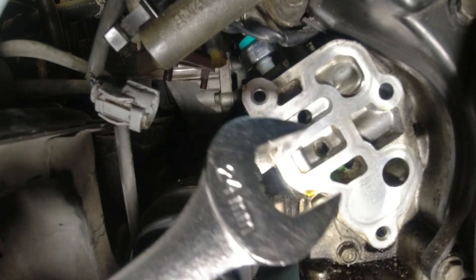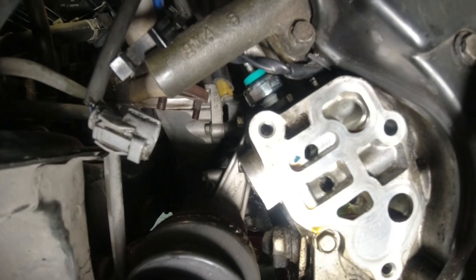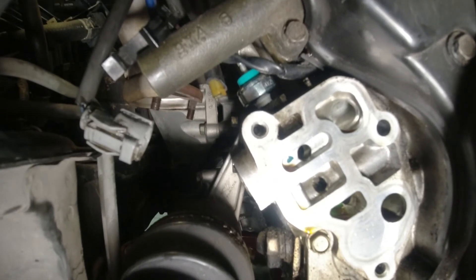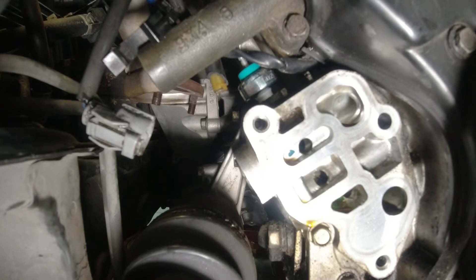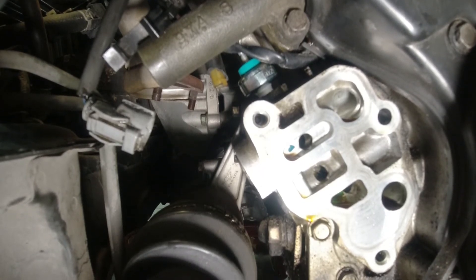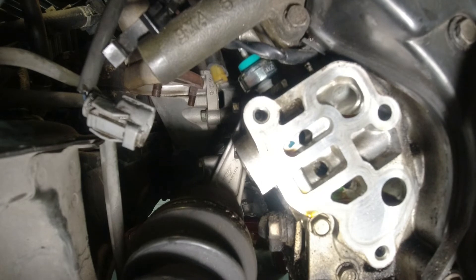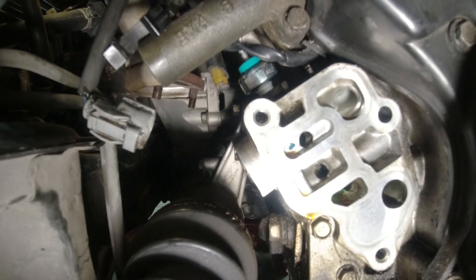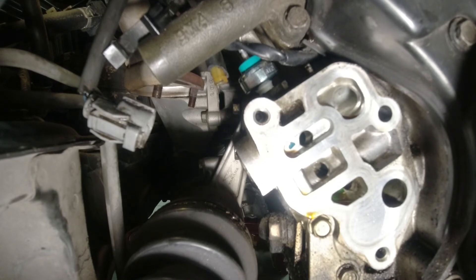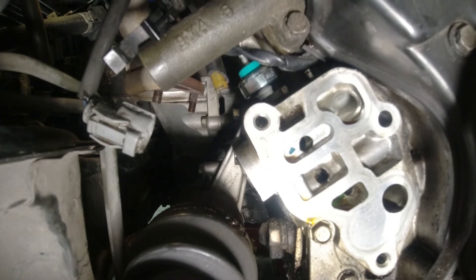Now I'm going to take my 24mm box and tighten that thing up. I've got Teflon tape on the threads. The threads on this oil sensor are 1/8 by 28 threads per inch, and it is ISO tapered — same as British standard taper. What that means is kind of like on a water heater: when you screw things in, the threads are tapered, which means you only have to turn it like three full turns and it's in. This does not have to bottom out all the way because these threads get tighter as you go in. About three full turns is about all you're going to get, and then it's good and tight.